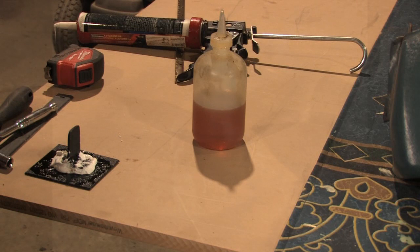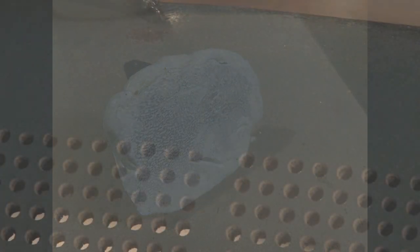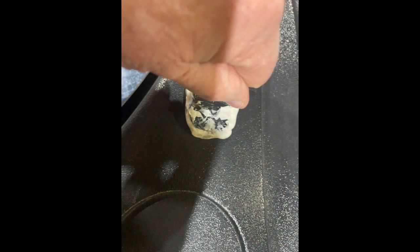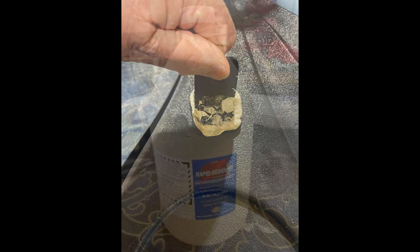After removing the silicone from the oiled surface, I let it set up for a few more days. I now have a pattern replicator for textured ABS. Fill the area to be repaired with Easy ABS resin and remove the excess with a body filler spatula. While the resin is wet, oil the pattern replicator and press it onto the resin. The pattern will transfer to the resin and make a perfect patch on the textured surface. I will be using this same pattern replicator to match the texture on RV fender skirts in the next video.